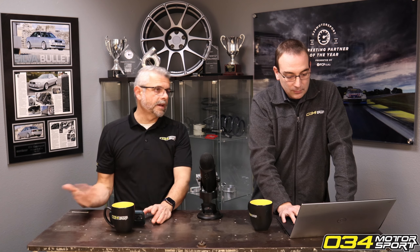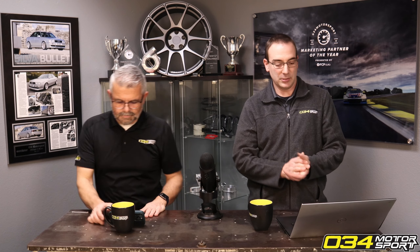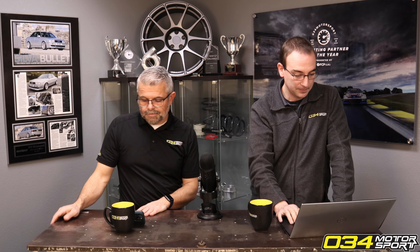There's nothing about our tuning that would change how the car starts. They were asking about E85 specifically, and yes, it's harder to light off, but we've been working on making that as solid as all the gas files. It's going to be nothing like having a hard time starting your car — it might crank one or two more times, that's not uncommon on any E85 file in any car because the fuel demand is a little higher on start. I wouldn't call that a hard time starting. It'll start just fine.